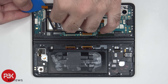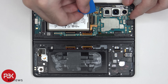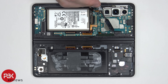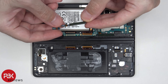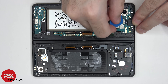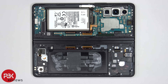Let's go ahead and disconnect those. There's one more flex cable in the corner that needs to be disconnected. This flex cable would be for one of the millimeter wave 5G antennas, and the second one is located right here with its flex cable. There are five more Phillips screws which need to be removed. Before I forget, we need to disconnect the flex cable for the in-display camera. Now we can lift up and remove the main board.